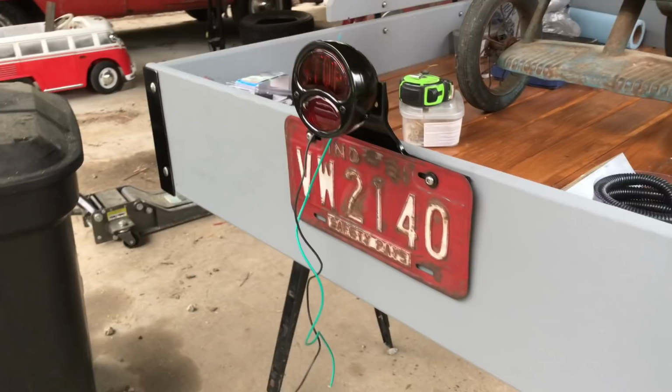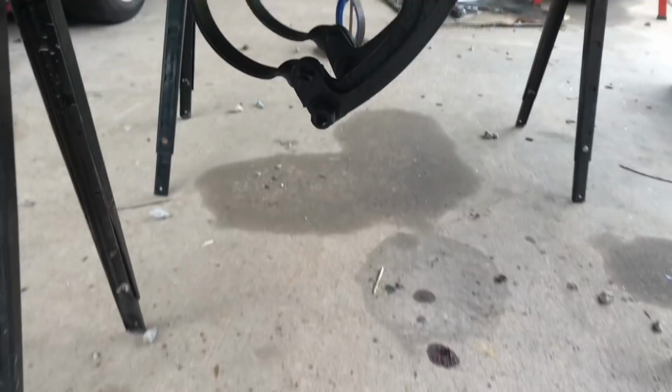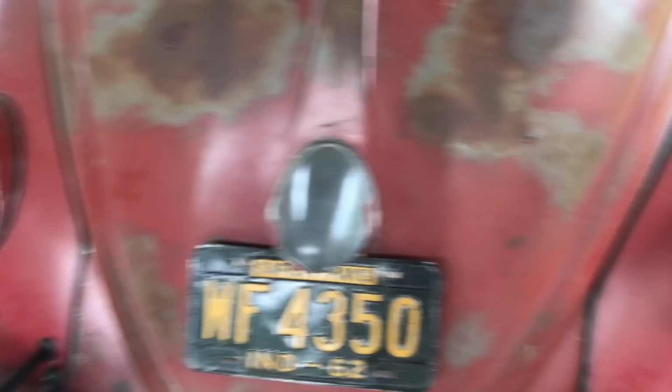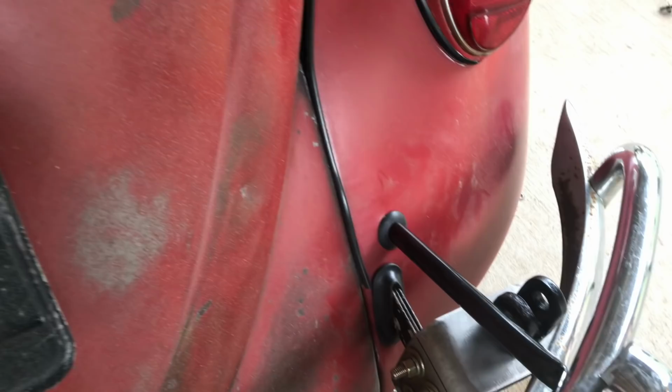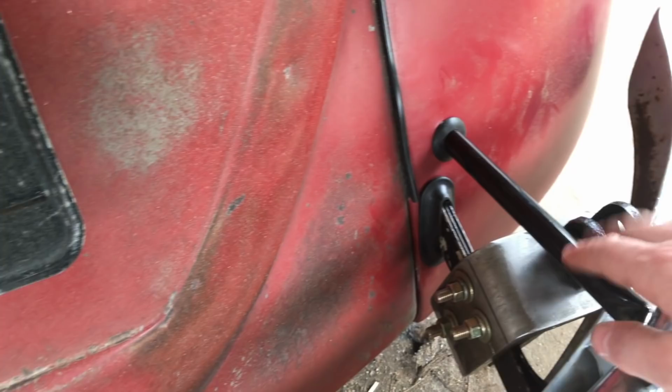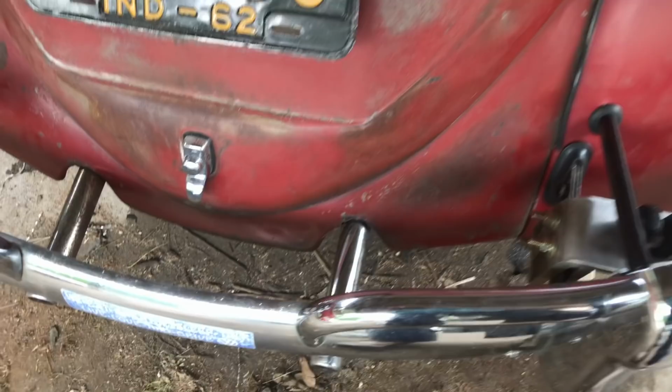So I'm going to put that wheel on there, the assembly we got all greased up and everything's ready to go on it. So I'm going to put the tire back on, got the bumper hooked back up on the car, had to take it completely off to add the bumper grommets and this fender here. You can see it in some of the other shots, but it has a rip right there. Some of the other videos I've put up. But put the bumper grommets on, put the bumper back, added the top bumper bracket, and I think that will be plenty strong. It feels really good.